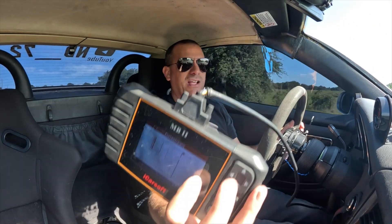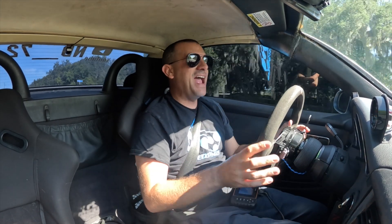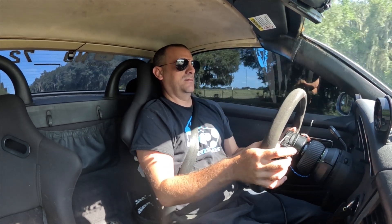We're going to do a nice little test drive. We're starting out at 50 degrees air intake temps — we've been hitting three or four pulls already. Going to do another little pull, nothing too crazy, just looking at some data. After the pull we shot up to about 116, but it's 96 degrees out — that really wasn't bad. And it's nice that the chill-down with this system is pretty quick; we're already back at like 57 degrees, so you can go pull to pull.